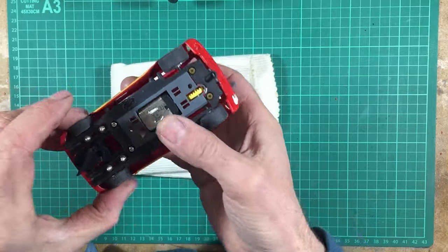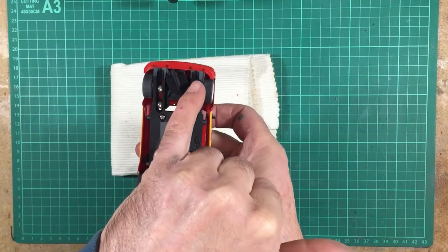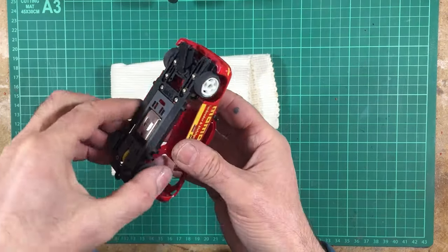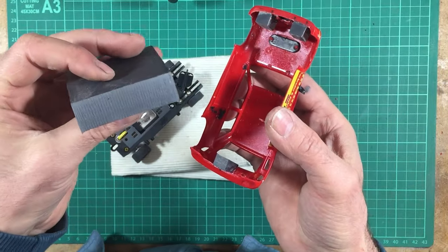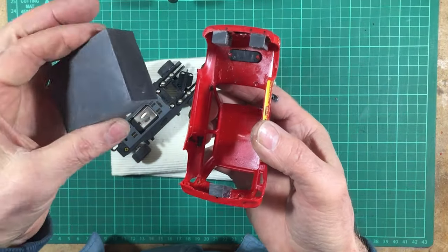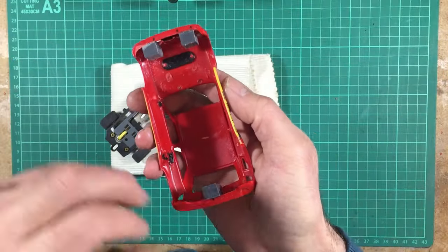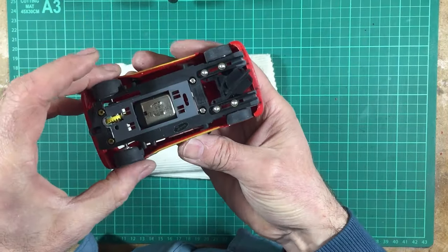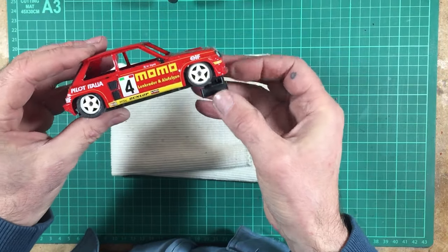So the rear block holds the rear mount, and the two front blocks are going to screw in at the end of these chassis rails. And all these blocks are is a lump of polyurethane cast resin just chopped up. I use this for my day job. It's just basically plastic, really. So I've cut three chunks and I've glued them into the body and obviously got them roughed in so that it actually holds the body in the right position nicely.